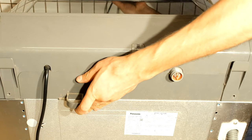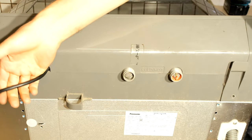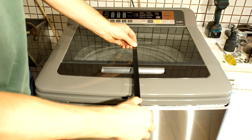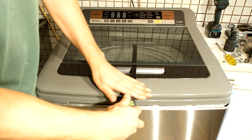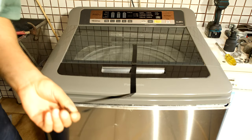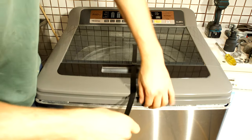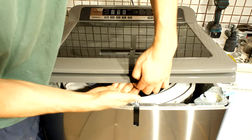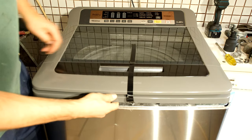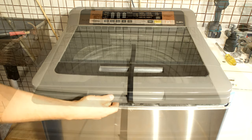This thing is now loosened. Obviously this is unplugged — just make sure it's unplugged before you take this off. It's just a good idea to tie this glass lid down. I'm just going to lift it a little bit, and with the tape I'm just taping this lid down so that if it does open it won't slam open and close repeatedly.